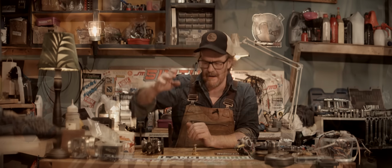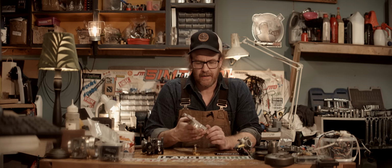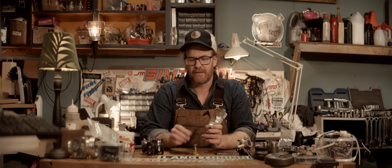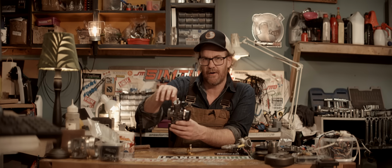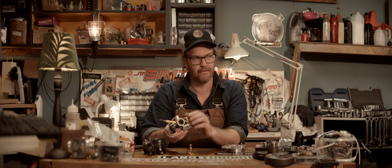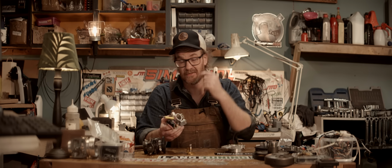Welcome back to my garage. Last time we talked about variator stuff, but what we're really working on now is nitro injection for my land speed bike. We started out with just pure nitromethane injection alongside a carburetor on a normal gas mix, tuned for a good AFR, and then just adding nitro. Then we started playing with a throttle body, throttle position sensor, and a do-it-yourself electromechanical injection system, and haven't gotten too far with that, and lots of trouble.